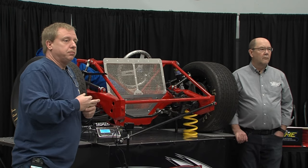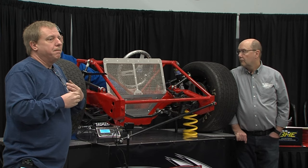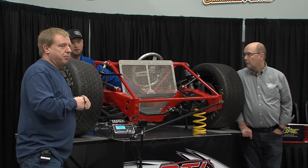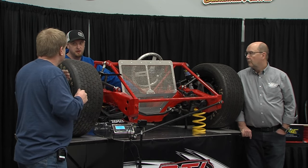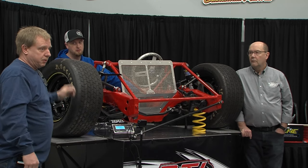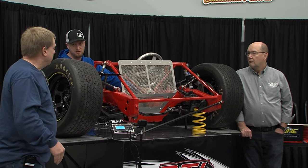You have to use the weight of the car. Do as much as you can just with the weight of the car setting down on it — when you put it all on, that's pretty much where it's going to limit you. You're definitely limited if you can't preload a shock or a chain of some sort. The other thing I'd say — with that light of a spring, you'll probably wear them out quicker. Watch your maintenance. There are some pretty good springs out there. Check the free height of the spring — if you coil bind them or go that soft, they will wear out fast.